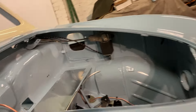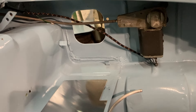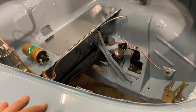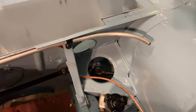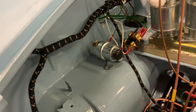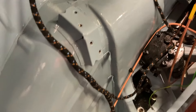The back end is all done. At the front end I'm doing more wiring — the wiper motor is all fitted in, connected up and wired in. I've bonded this plate to the top. All the brake pipes are in and connected, and the silver one there is the fuel pipe from the fuel pump. The solenoid is probably going to sit there, and I think the coil is going to go down there because it'll suit the wiring better.